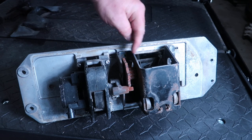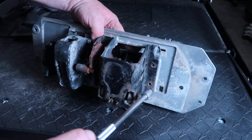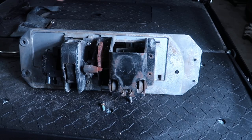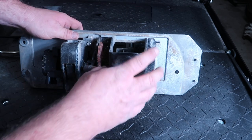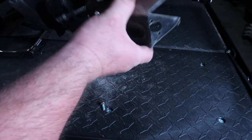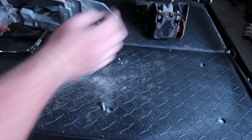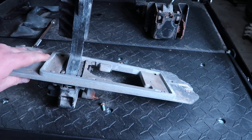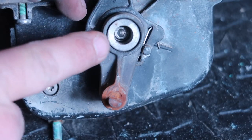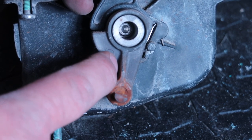Now the first thing we're going to remove is the brake pedal assembly. It's going to have four bolts — that's going to take a T30 to remove all four of those. There's going to be one at the top left, two on the right hand side, and one down at the bottom left. When we remove the brake pedal assembly away from the pedal group, we're going to need to turn it around backwards before we pull it out — and it slides out just like that. Now once you have the brake assembly off, this is the piece we're going to be replacing. Looking down into the end of the shaft, that's the bolt we're going to be removing so we can remove this assembly. I'm going to use a T25 Torx instead of the Allen key.